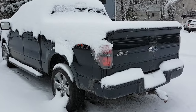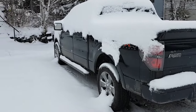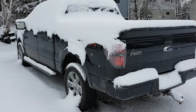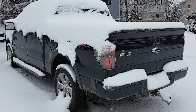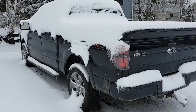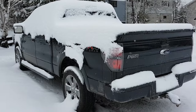Today I have a 2013 Ford F-150. I was driving it, pulled up to this house, got back in my truck, and it won't start. It started up, then went to a very low idle and died out. No throttle response whatsoever. I figured it was something with the fuel, and it ended up throwing engine codes P00C6 and another one basically saying fuel pressure was too low.